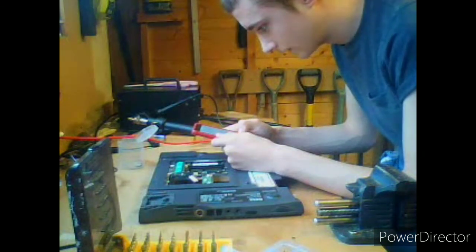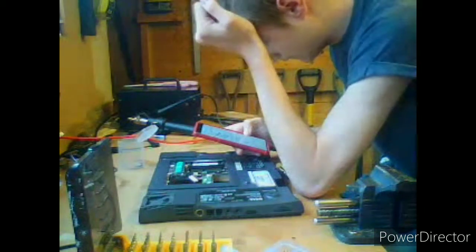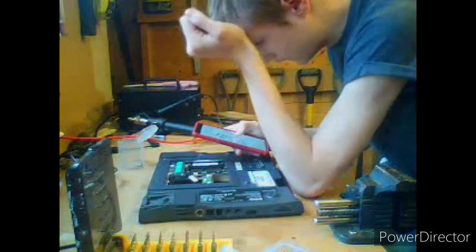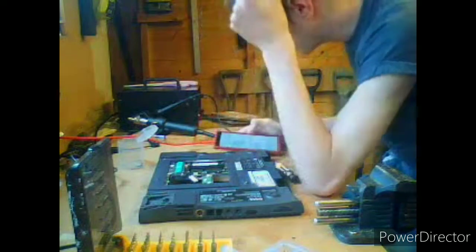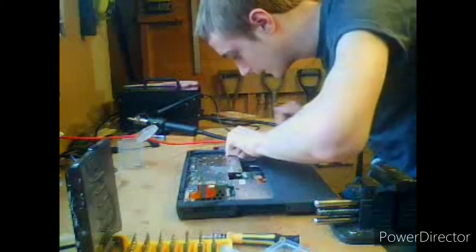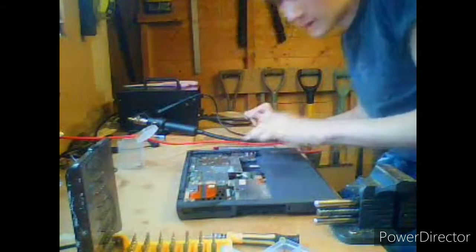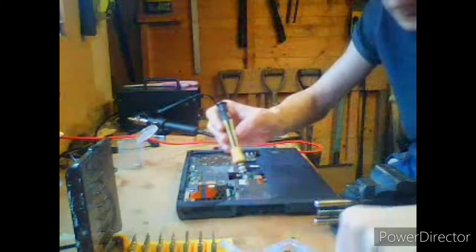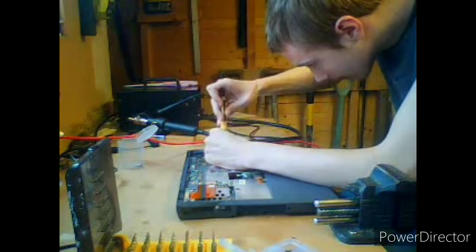Okay. Remove the back hinge cover and display assembly. So, oh, I don't know. We've got to follow this from the back upwards. So we plugged in the palm rest. We've put in the thing underneath the keyboard on the right side of the bottom case assembly next to the processor cooling. Okay. So there's a screw over near the CPU fan assembly, which I see right there. There it is. So what is that? That's M2-3, which, oddly enough, is the same one I used last time. Weird. Okay, gonna insert that there.